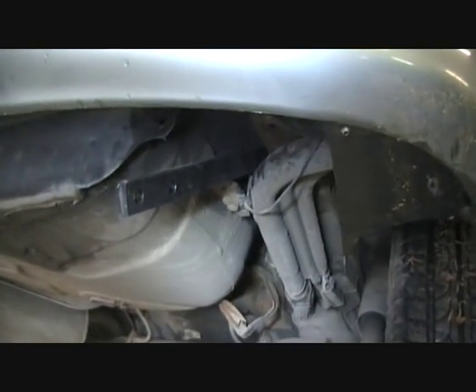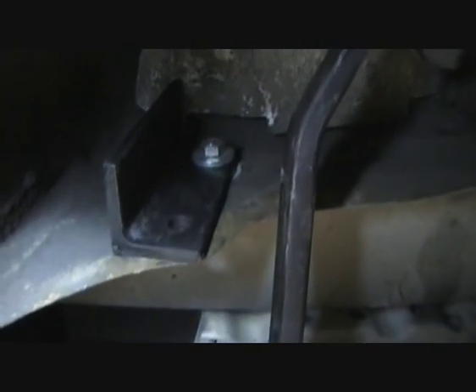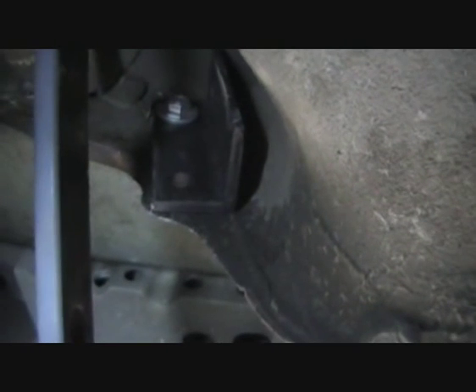I have my two side mountings in — the main mounts go to the chassis rails on either side — and I also have the mounting on the back chassis cross member, which is an angled piece in there, and another one on this side. So I'll start fitting up the actual tow bar frame now.